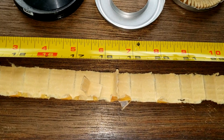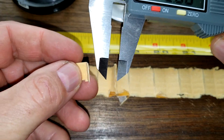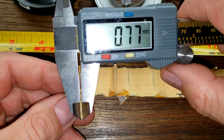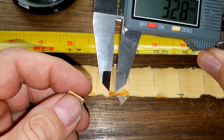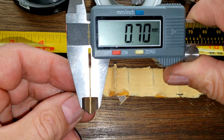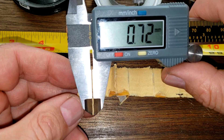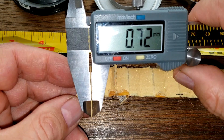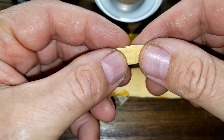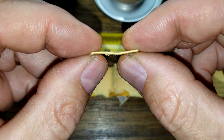Here she is at the seam. I cut a little sample to measure the paper thickness: 0.77 millimeters at one spot, and 0.70 millimeters at another. It's probably right around 0.71 to 0.73 millimeters — pushing on it changes the reading, so it's approximately 0.717.